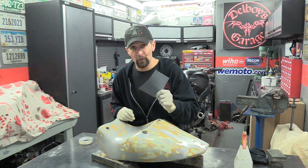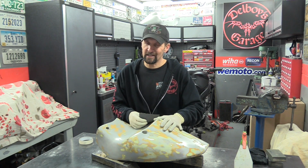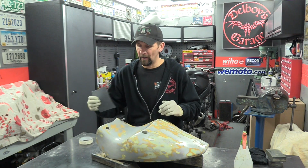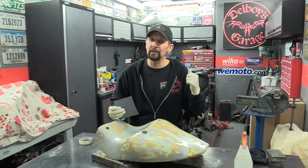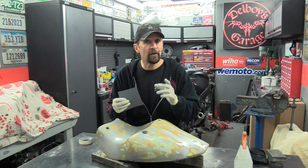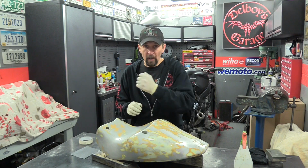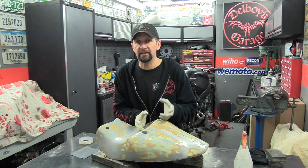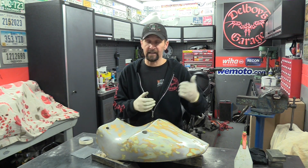So to answer that too, because there's loads of you said in the past you shouldn't be using 1000 grit for the final sand before painting. That's a polishing paper, etc. But remember, the reason I'm doing this, it's worked for me. It was advice from Milo years ago. 1000 grit or even 1200 if you can be careful with it, and that gives you a super fine finish when you come to paint. You need that with satin and matte paints because you cannot correct them or buff or polish them afterwards. How they come out of the gun or can is how they remain.